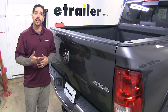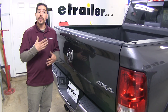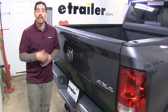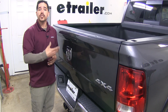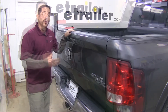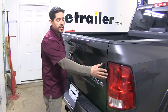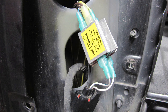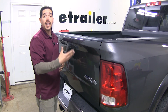If you're flat towing your Ram you're going to need wiring so when you're going down the road everybody knows whether you're coming to a stop, making a turn, or it's at night so you can have the taillights on the back of your car. Our diodes are going to allow us to accept the signals from our RV — like brakes, turn signals, and taillight signals — and transfer them to our Ram so we can get down the road safely. It's also going to protect our vehicle's wiring from any kind of back feeding that may happen on the motorhome end.